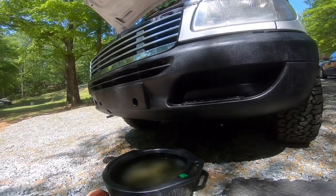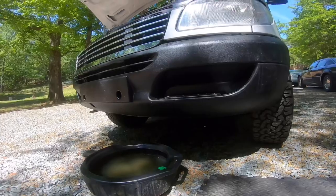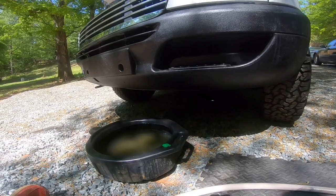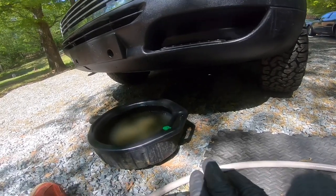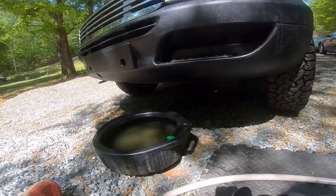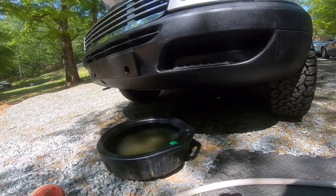As far as the proper way to add coolant from scratch — what we're doing here is we just drained the coolant and we're trying to get the engine clean. When we completely flush the engine and it's just water in there, when you drain the radiator there is still water inside the engine — that's why we're still getting this orange stuff. Once the water coming out is clear, we know we have plain water inside the engine. At that point, a 50/50 premix is not going to work because you'd use two gallons of it in the radiator tank and that's it.